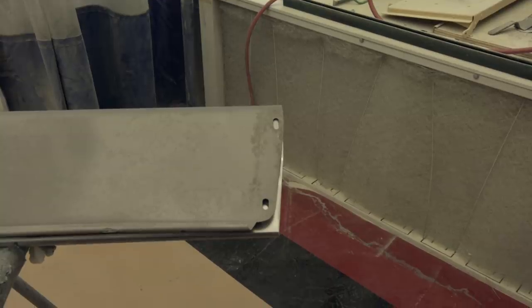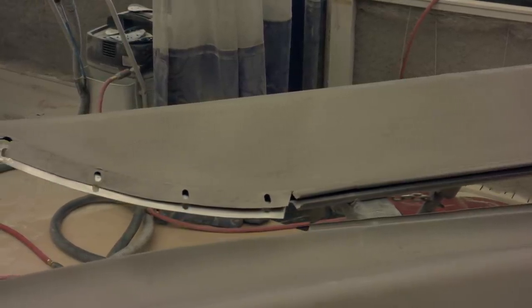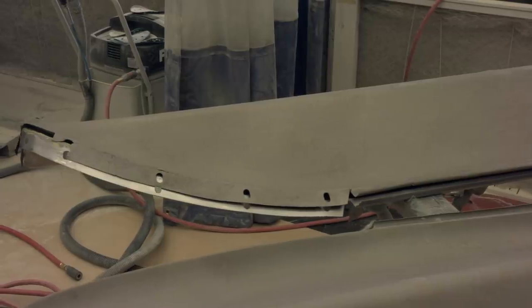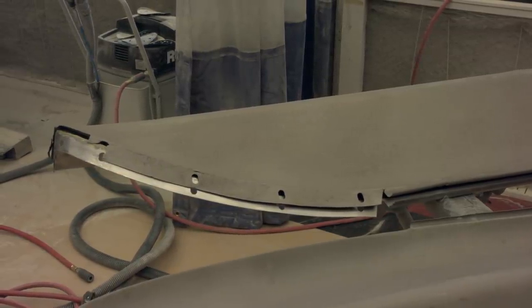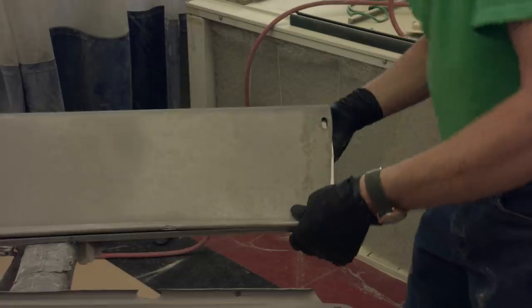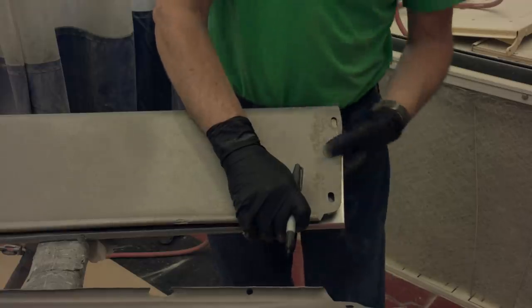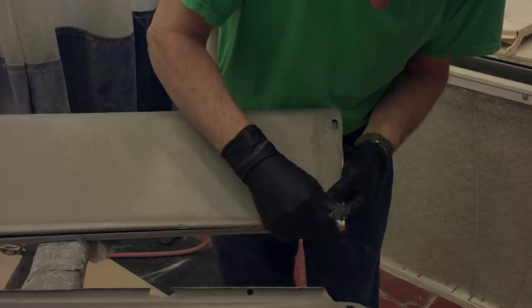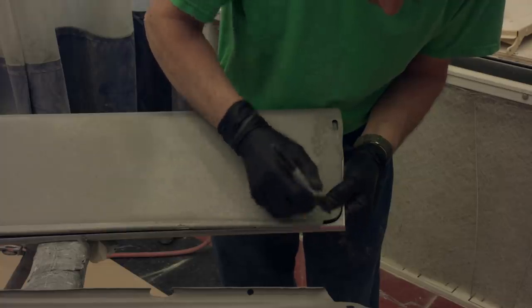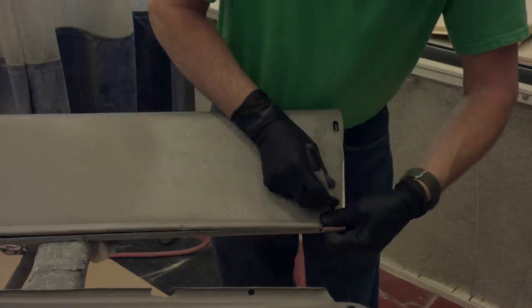The decision point was new or used, and the roll on the bottom side of these splash aprons was beautiful. They used to be a V bottom and one of the powers that be in the Model A world told me that most every restorer that restores high point cars uses the new ones — they just round off that bottom. Guess what? It's already round. So what I did is I just took the old one and marked it out exactly like the new one, because they don't trim the edges quite right. This is a whole lot easier than working those originals. And they really are a nice reproduction — they fit up very well. We just got to go in here and trim all this stuff off, cut the holes in it and make them look exactly like original.